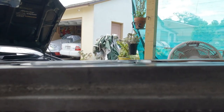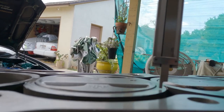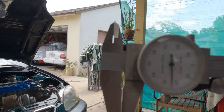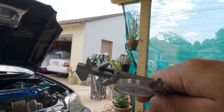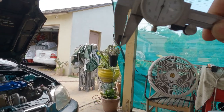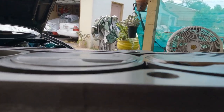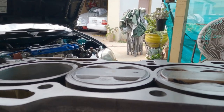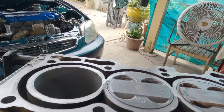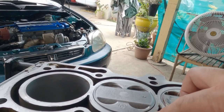There it is — that's what it looks like with the H22A4 piston on the F23 rods, whether it's an H22A4 block or an F23 block. It sticks out more than 20 thousandths. If you have a Type S piston you'll have more compression ratio because the dome sticks out, but once you put a head gasket on — which is 26 thousandths — it's almost flush. Some people don't have a problem with it.